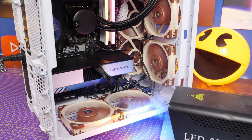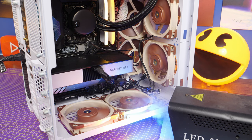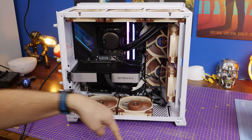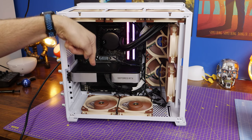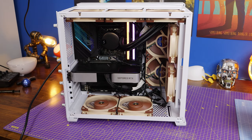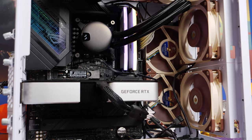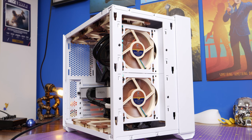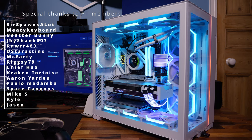In this setup I'm essentially making the GPU and the case fans fight each other — the graphics card fans are trying to suck cold air in, but the fans on the bottom are also sucking it out, so they're going in the wrong direction. The hot air is rising and the airflow is completely illogical. The end result is a case that theoretically looks okay at a glance since all the fans are spinning, but it obviously isn't going to work very well. So don't do this — make sure you've got the right logic: front fans set to intake, bottom fans set to intake, exhaust fans on the top and rear.